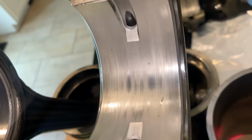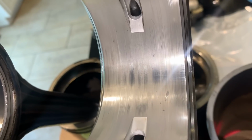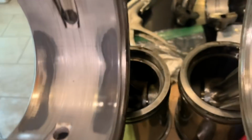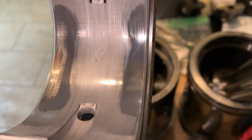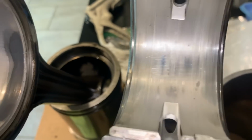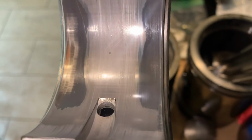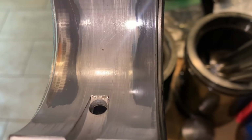Nothing catches the fingernail on there. There's a little bit of a weird wear pattern on it, but it's perfectly smooth. I don't feel anything. I was curious how the propane was affecting the engine, and this wear right here on this rod bearing. If this one looked really crappy like these, and there's some others out there that are even more wear coming through like that, you know, the different colors when we get into the copper and stuff.